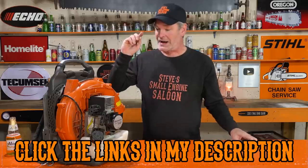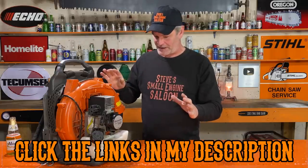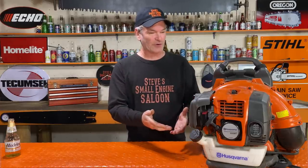Now we're going to button this all back up again, and we're going to go break this thing in. Give me a couple more seconds. Let's do it. Done. Moment of truth coming up here. Everything's back together. I got some fuel in there. And what I like to do in a situation like this is, I call it a break-in period. I like to just run it, idle it, rev it up once in a while. Just let those piston rings gently and nicely seat themselves into that cylinder. So that's what we're going to do. Let's go outside. Hopefully this starts, and we're just going to let it run for a little bit. Then we'll take it from there.